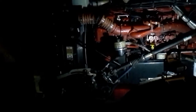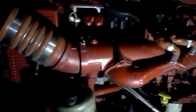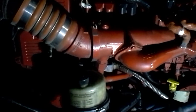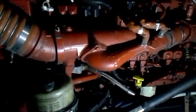One of the first things I do in my hood inspection is look at engine components. The first thing I look at is the air filter — is it dirty or restricted in any way? That could lead to the engine running codes or just overall running poorly, which prevents the driver from having to take the truck to the shop unnecessarily.